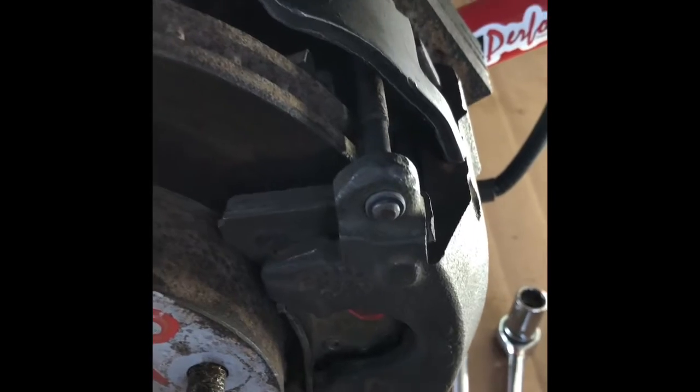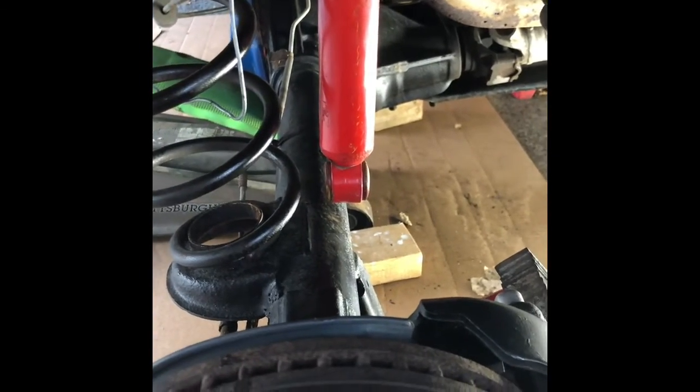This is what I did. I got the torque arm on, and I checked all the plumbing, made sure it's routed correctly. Then I put the calipers back on. Pain in the neck. I just got done putting the control arms on. And now I'm going to jack it up, set these springs, put the shocks on, then the Panhard bars. I guess I'll do the Panhard bar last. Then I torque down these bolts last, because they have to be under the weight of the car before you torque them. That's the order I did it. I find it seems the best way. If there's another way, I don't know.